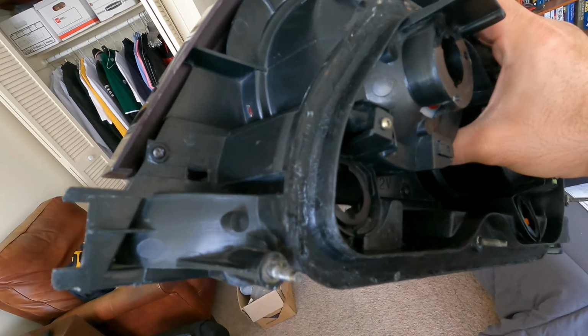Here's the sealant I'm going to use. Bought it off Amazon. Butyl windscreen sealant. It's the same stuff for taillights. This is a horrible design by Nissan. Absolutely horrible. It's got to be one of the worst in automotive history. And they changed it on the 34 to actually close up this entire aperture that's created in the back panel of the GTR. So that's totally closed up, and there's only a single hole, basically dead center. And then the taillight actually sits on the outside of the vehicle, so there's no real chance of it leaking. It's like a fully sealed unit. So that's why you don't have this problem on 34s, but because I have a 33, you get this.